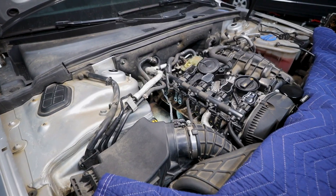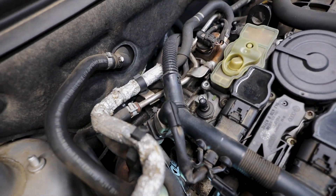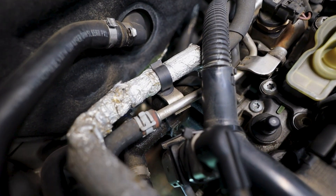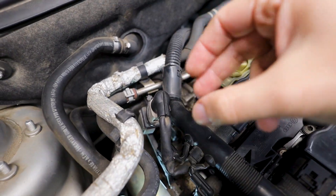Someone was coming to see the car. It had been sitting outside, not being driven for a couple of weeks at this point, but otherwise it was running perfect before this. I figured I'd pull it into the garage to be a little more comfortable. I started the car, pulled it around the back, and by the time I pulled into the garage about 30 seconds later there was smoke billowing from under the hood. I could see on the very top of the cat it looked like there was something wet that was clearly just burning off, and straight on top of that is the vacuum pump on the back of the head. The signs were pretty obvious right away — we had an oil leak, with a little bit of oil overspray down on part of the vacuum outlet hose.